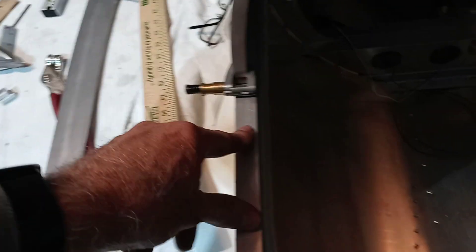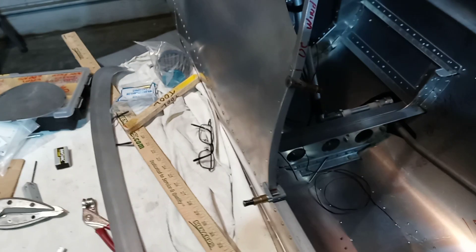On the H5, the side rails were a little wider, so I put a little L bracket there to rivet down to the side rail and then onto the bow to hold it in place. But on the first Ultra Cruiser, I machined these little square things to go up inside the bow, and then I'll drill a hole in the side rail and put — I made them 6-32 — and then put a 6-32 bolt up through the bottom to keep this from going back and forth.